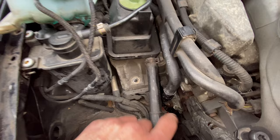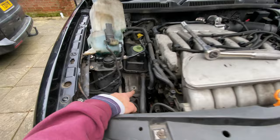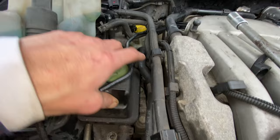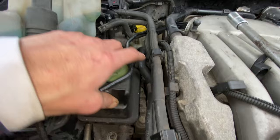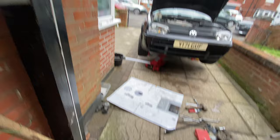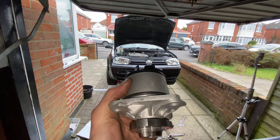Unfortunately I haven't filmed a great deal — all you'd be seeing is my back because there's no room in here at all to work. The water pump has completely drained out, I've removed the bolts for the engine mount, the pendulum bolts are out, and the engine is on the trolley jack. I'm slowly bringing it up making sure nothing's fouling. I'm just going to put a bit of coolant around the seal before I push it down, just to help lube and seal. I got the new water pump from Euros for £34, happy days.